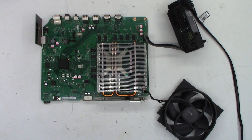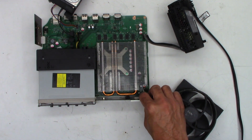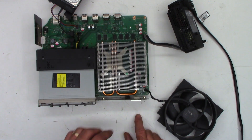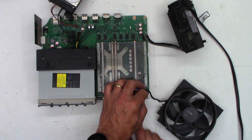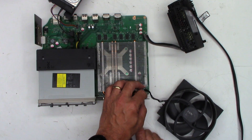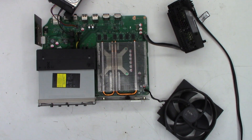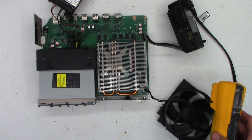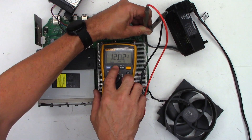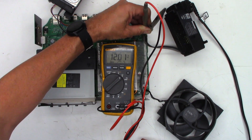Let's try to hook up the hard drive and see if it makes a difference. I do have the hard drive and the DVD drive connected at this point. And I don't get a power light this time, I get the beep — and then it shuts down. It acts like it's going to work. It tries to work and then it shuts down. Let's measure the 12 volts coming out of the power supply and just make sure the power supply isn't faulting for some strange reason. I do see 12.02 volts. Let's go on min-max — minimum is 12.01 volts. Not the power supply.